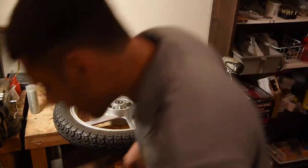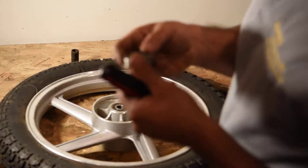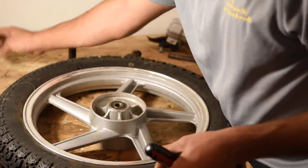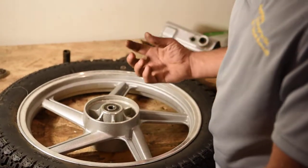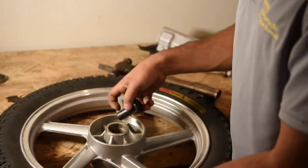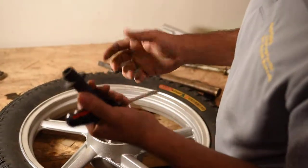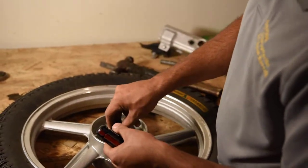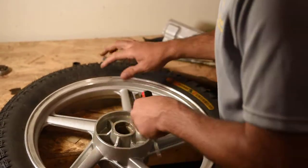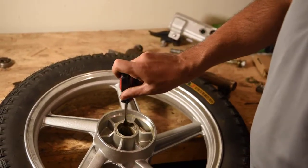There you go. Now that you have the old one out, you might have hit the seal that covers it — and that's fine. You want to take the other one out as well, so you just flip that over and now you have a lot more space to get in there. You'll have the shaft in here as well, which might be sitting out here. You're going to have a rubber gasket, which is basically just used to hold the shaft into place. You're going to probably have quite a bit of rust in there and lots of other stuff. You can clean out this lip — you see this is the shoulder that the bearing rests on.